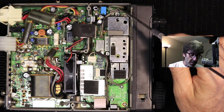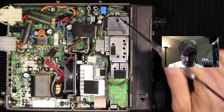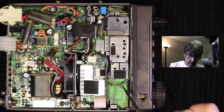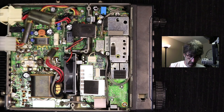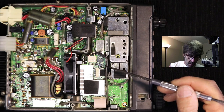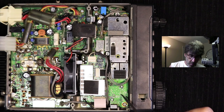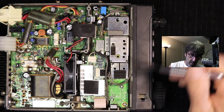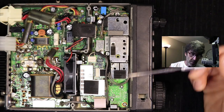These connectors here don't really have to come loose — this one just goes through from the other side, you can move it out of the way. These wires here you've got to be careful with when you put it back because they tend to get pinched underneath — watch that they slip between here properly. Take those out, take the ribbon cables out. This board will come up and flip over. Just don't stretch the cables too tight — just flip the board over and then you can get to everything.